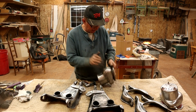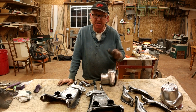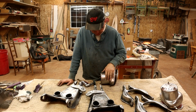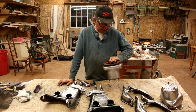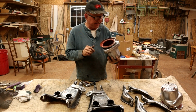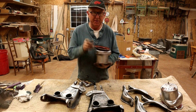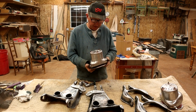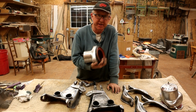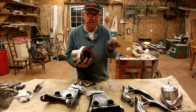I'm going to use a 2-pack, 2K epoxy primer, a couple of light to medium coats, let that flash off. For these I actually took one of them in so they could sample the colour on the inside at the paint store, and one of the members asked if I can give them the code. I called them about that. Normally it's printed on the can when they mix your paint, but they said unless it's the same paint, the codes are not going to be the same, or the quantities or the pigmentation.